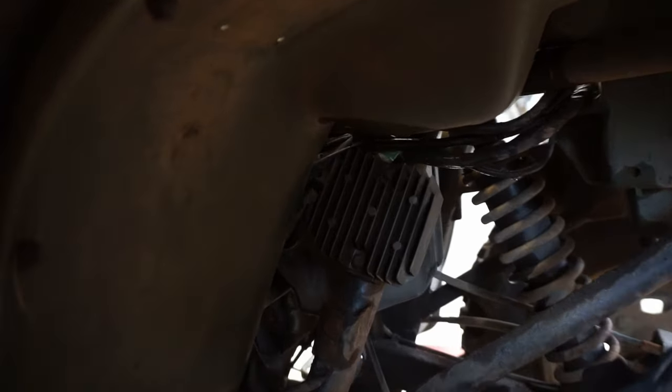All right, so that's perfect. So that tests out. Then the yellow wires already tested. We're looking for 0.09 to 0.1 ohms between the yellow wires, and those check out. So I don't think it's a stator. Those check out good.